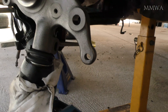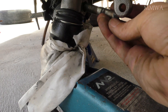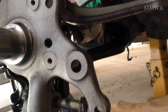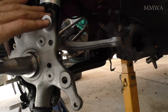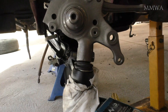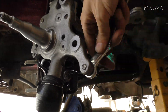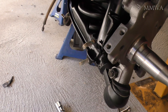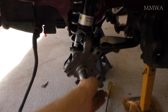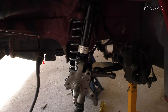Be aware that I have put this bolt in the wrong way around. Originally it did come in from the left hand side — I don't know if that makes any difference or not. I reviewed the footage when I disassembled it and noticed the error of my ways. If it becomes a problem I don't have an issue just removing it and flipping it around. This is the stop that prevents abnormal noises apparently when you're at full lock — there's one on each side.